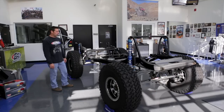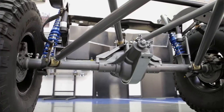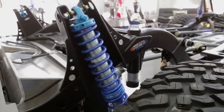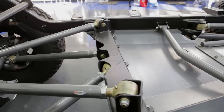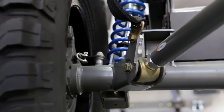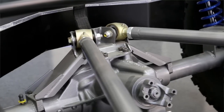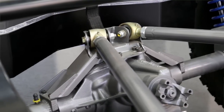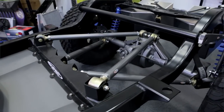Let's start at the rear of the Jeep. We've got a four-link rear suspension with King long travel coilover shocks. In this case we're using a double triangulated rear crossmember. All the brackets are quarter-inch thick — on the axle, on the frame — it's the kind of thing you do once and it's going to hold up. We've got all the right geometry built in here to maximize the space underneath your vehicle.